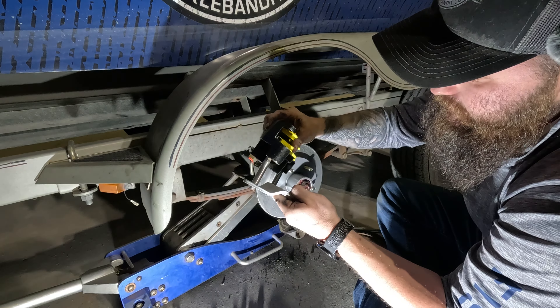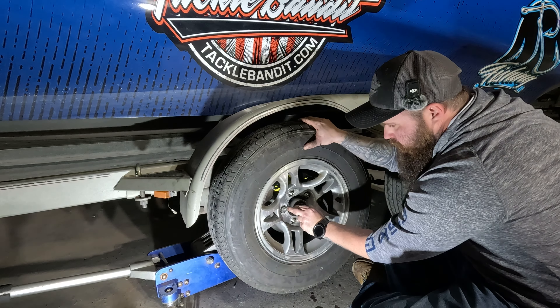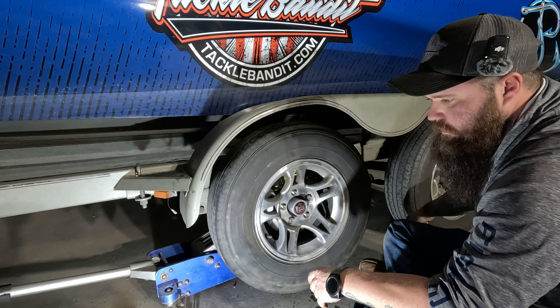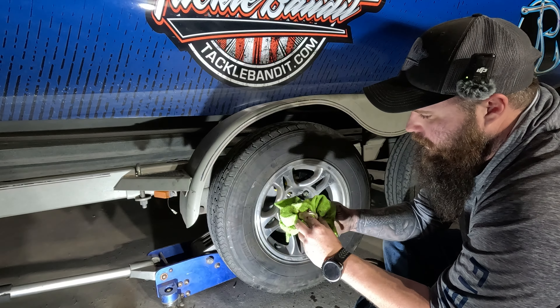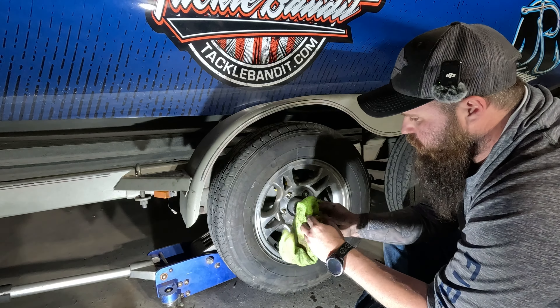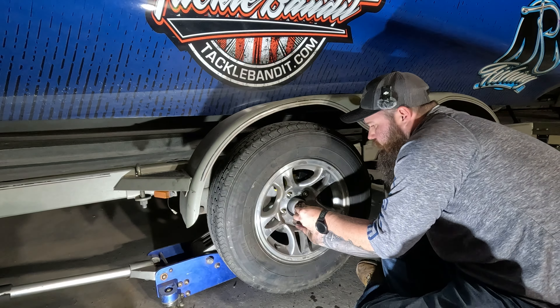Now it's time to make our final adjustments on this hub nut and get ready to lock it in place, then we'll put the cap on. We're going to throw the tire on — this sounds counterproductive — but before we get this nut all the way tight, I like to put the tire back on without the center cap and without the dust cover so we can tighten two lug nuts and check for play in this bearing before we get it locked down. We've got the wheel back on with two lug nuts, and we're just going to give it a little push-pull to fine-tune that nut so it's tight enough to keep the slack out but loose enough it still turns free.